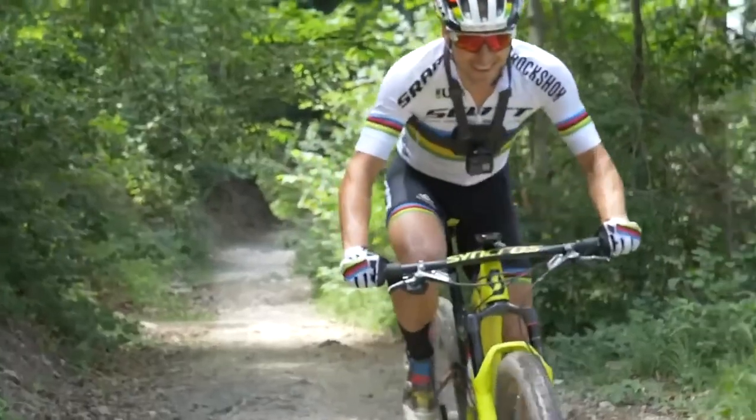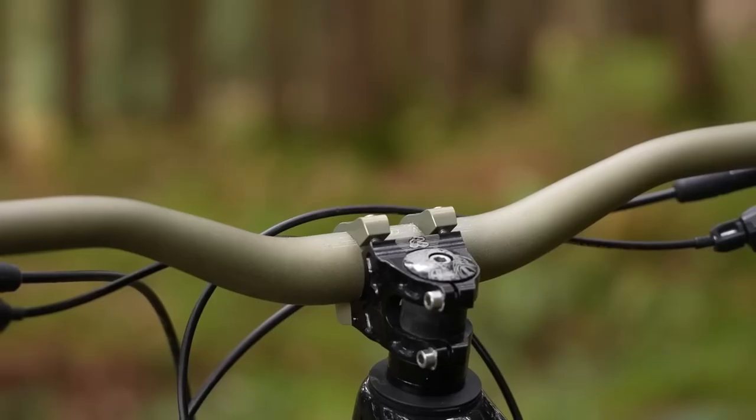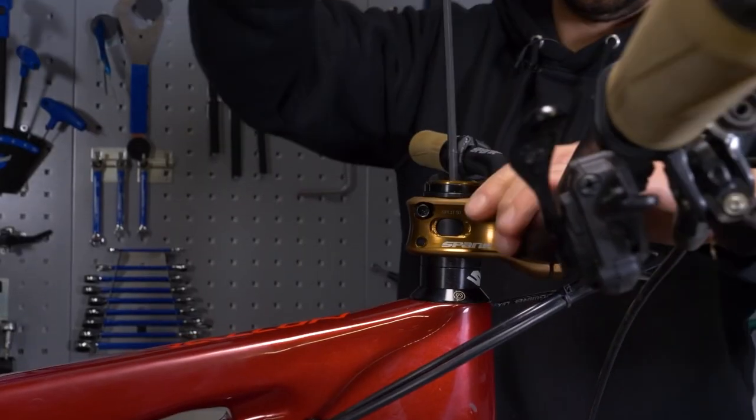The difference is also slightly personal preference and aesthetics. XC riders love to slam their stem right down to the frame with flat bars and they like the look of that. If you wanted a slammed look but found the stem or handlebars too low, you can effectively correct it with higher-rise bars. Equally, a lot of enduro riders always have high-rise bars — if you don't like the height of those bars, you could keep high-rise bars and just bring the stem down a little closer to the frame. Just be aware that moving the stem changes the reach slightly.